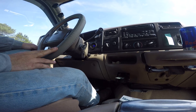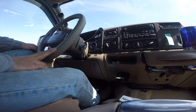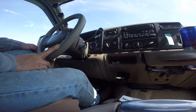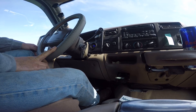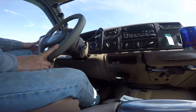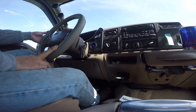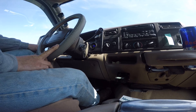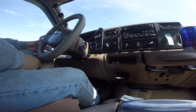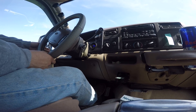This is a 2001 F250 7.3. Right now I have it on the 100 horsepower setting with the TS chip. I can't run it too hard because my EGTs get so high so fast. I have on order a Banks exhaust housing and new stainless steel uppipes — hopefully that will help bring it down a little bit before I have to go to water meth injection, and that's going to be soon.